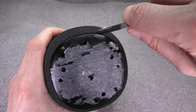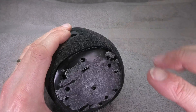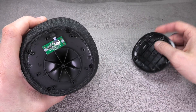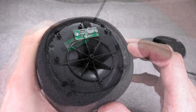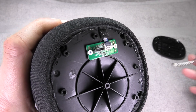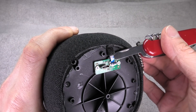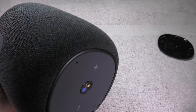Once all screws are removed we can detach the bottom plastic plate. I'm using a little prying tool — just my old pocket knife — and we can pry relatively easily between the fabric and the plastic to detach this big piece of plastic. Underneath we find four more Phillips screws to remove, and also a little daughter board with a micro USB port, which seems to be a service port connected with a ribbon cable. I flip open the little switch and remove the ribbon cable so we don't accidentally tear it apart.